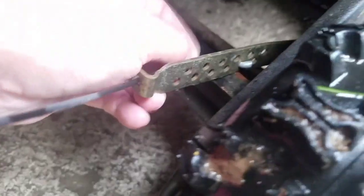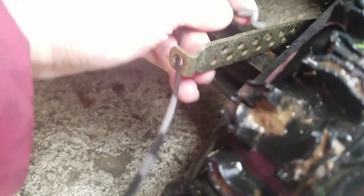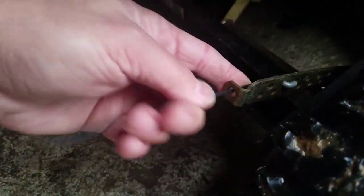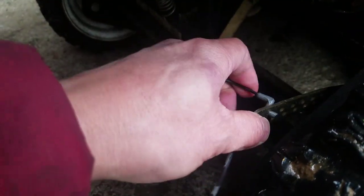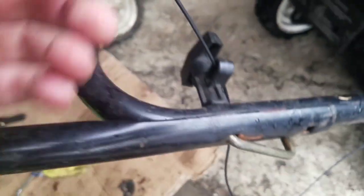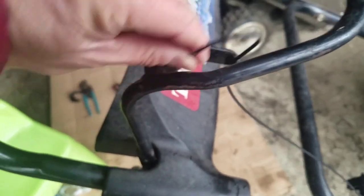Once you have all the slack you want, you can see the holes. I'll put it up about an inch — actually I'll do another half inch more. There we go. Then we just connect the Z-bend back again. Really easy to adjust provided you have the right length. Now when we pull this — oh, that was too much. See, now it's flush, however it's way too long and it won't even engage, so I was wrong.